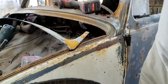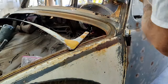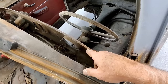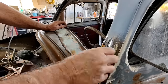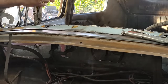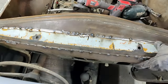I would reuse the Citrus Strip — just take it back up with the paint chips still in it, smear it over again, and it would keep stripping. It doesn't work very well on heavy two-part urethanes or clear coats, but it works fine on old material like this. I wish they hadn't outlawed the stronger stuff.